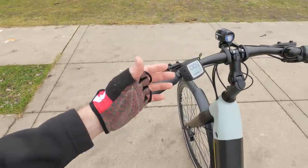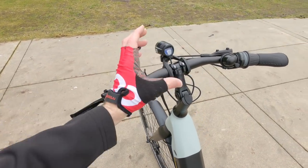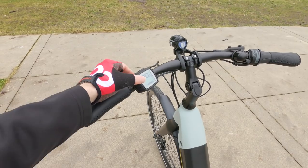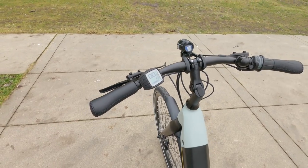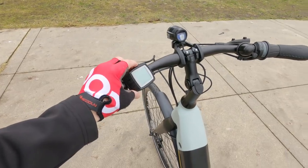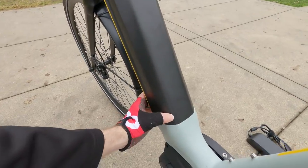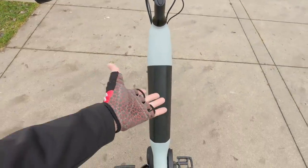There are a couple times where maybe I haven't ridden my bike for a while with a Bosch drive system, and some things like the display, I've only seen this on the Intuvia, which is the bigger one that's center mounted, I'll try to turn the bike on and the display comes on, but I can't change assist levels. I'll click plus, and instead of going up to eco, like you see here, it goes up and then right back. And I never know what's going on. Well, what you can do in those cases is turn the bike off and then turn it on using the battery pack. So if you find yourself struggling, if there's ever some sort of weird issue up here, start it from the battery pack, like I just did, and maybe it awakes the battery up or something like that.